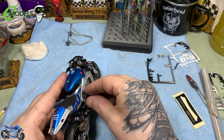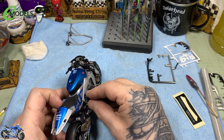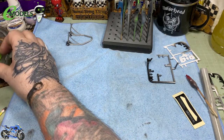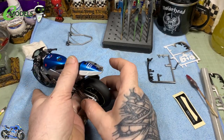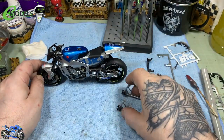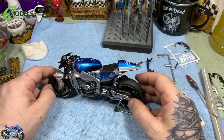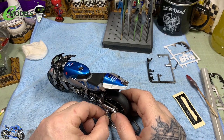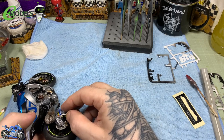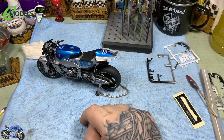So, yeah, it's really quite surprising. All right, we can put the clutch cover on. So that just sits on its locators, just on the side there. Get that into place. Right. Look at that. Oh, let's just drop that on the stand. And there's a couple of little lugs that stick out on the side of the swing arm there, and all they do is they just rest into the little cups on the top of the paddock stand, like so. It just sits there quite happily then.